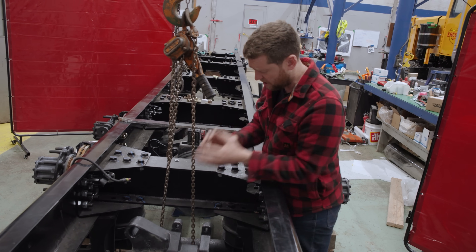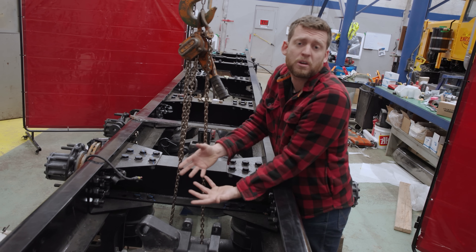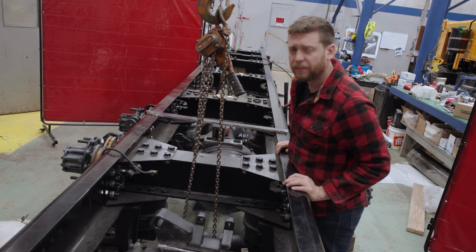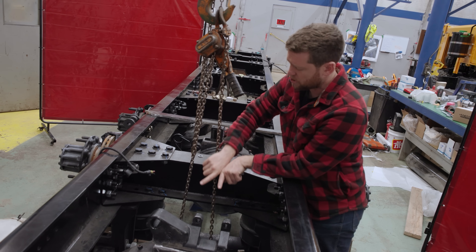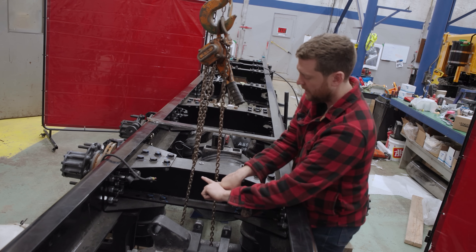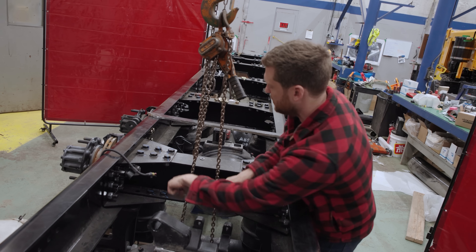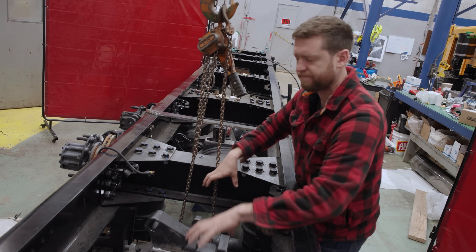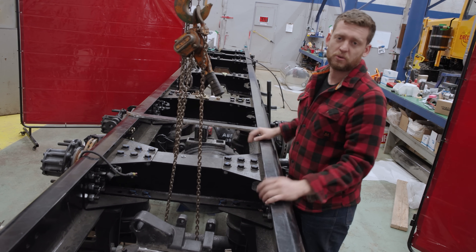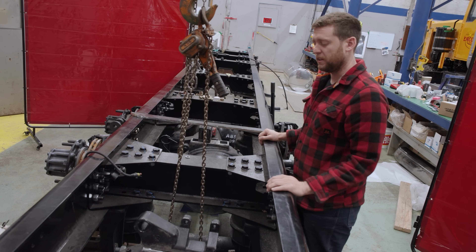It's a little bit of personal experience and bias, but I like it. It's also easier to find — that's just a common torque rod. You just need to know the length and you order that torque rod length and bolt it up. You don't need to go find a special custom-made torque rod in a wishbone configuration. So rather than having one center point with two running out, just keep it simple, easy to repair, easy to source parts. That's why we're welding on this style.